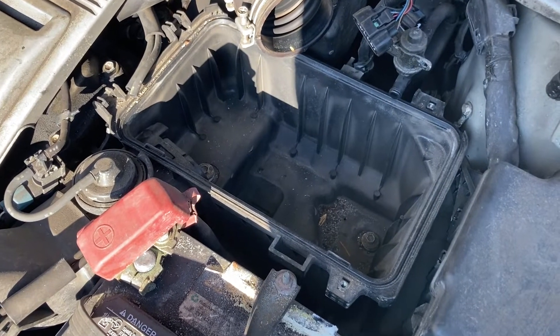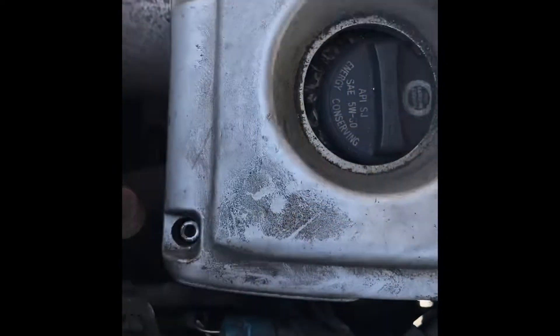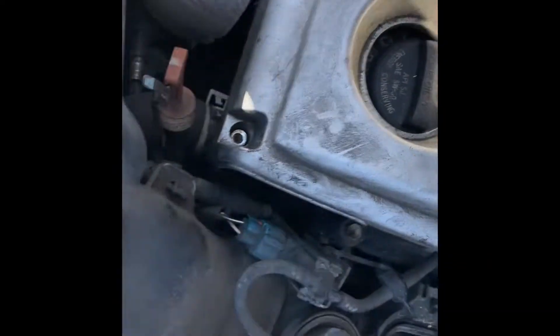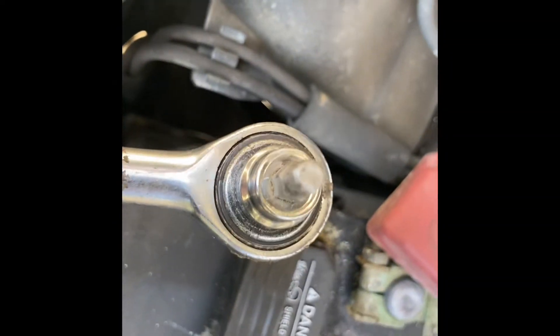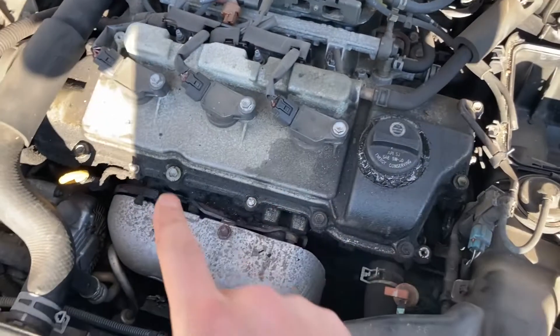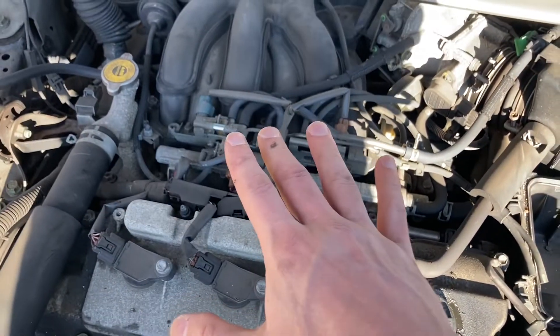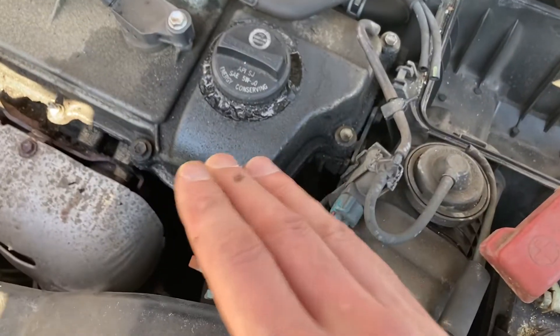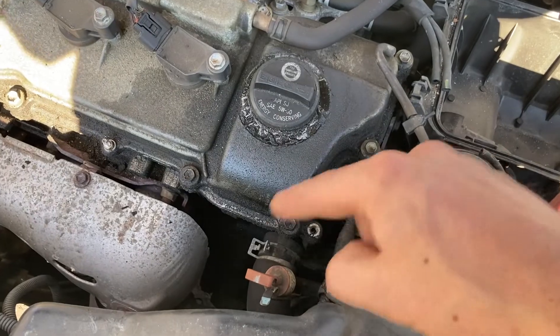Some people do like to service this O-ring. Very quickly, you have these Torx screws that you need to undo — they go across the rail right over here: one, two, three, four. Then you just pull it up. The tool I used was this right over here. Once you remove the engine cover, you actually have access to three spark plugs right over here. The other three spark plugs are a lot harder to get to.